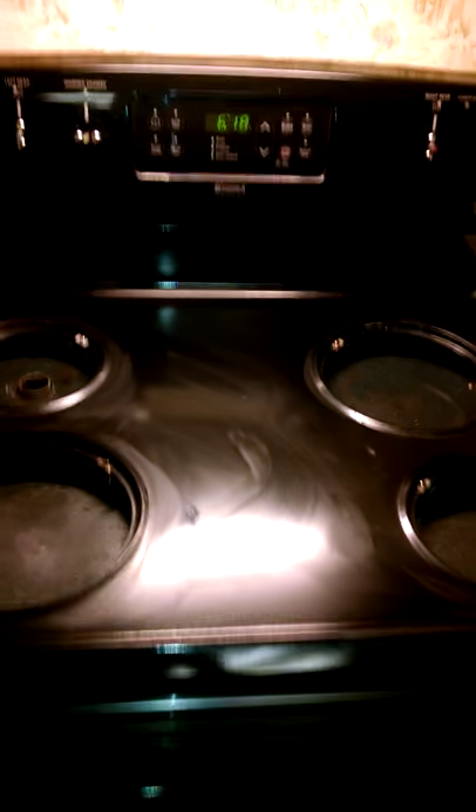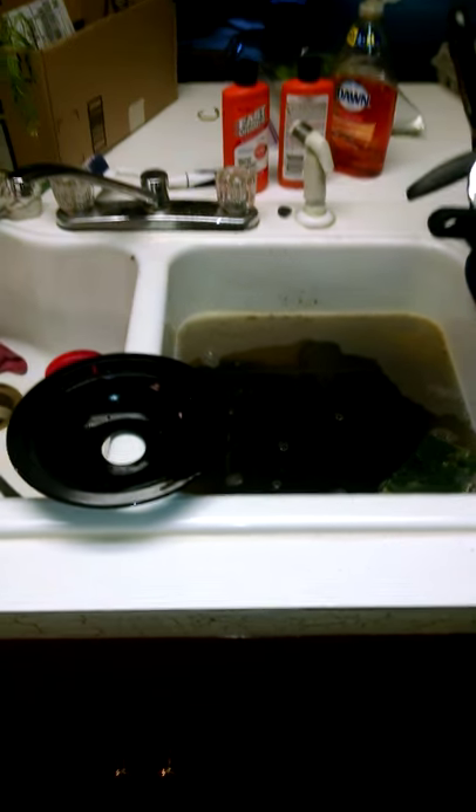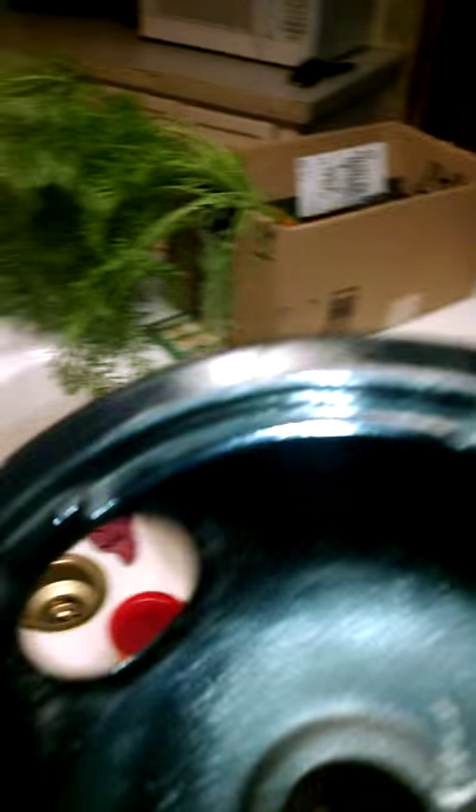What we started with is taking the degreaser and cleaning the top of the stove the best we could, besides the build-up around the burners. We took the burner plates and burners out and got them soaking in the sink. This is pretty much what they looked like before — all dirty with build-up. I took some cutting compound and then some polymer sealant and polished this out at about a thousand RPMs. Used a little bit of 320 wet sand on the bottom to clean it out the best we could. Got it shined back up in decent condition.